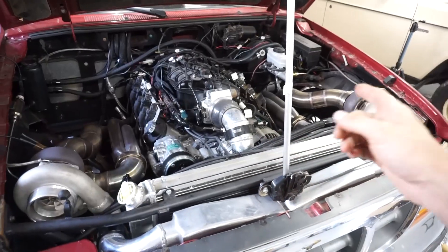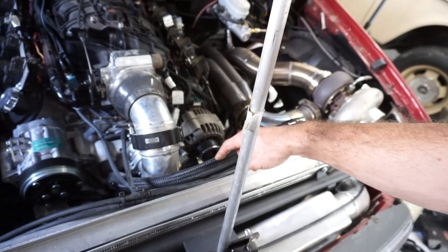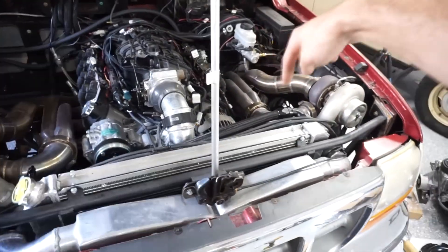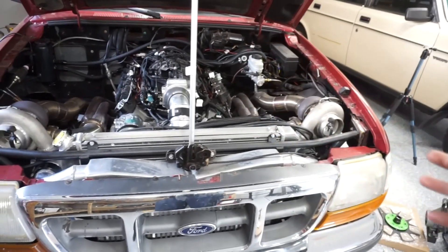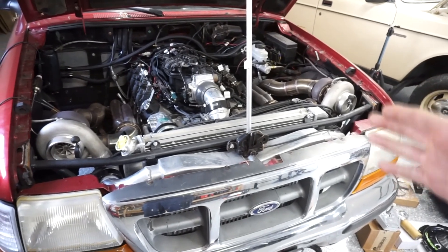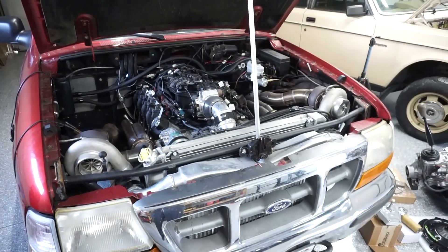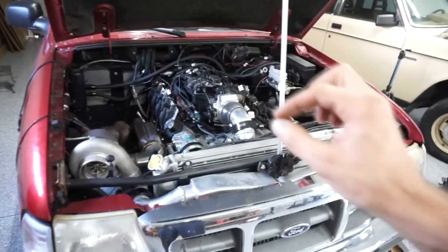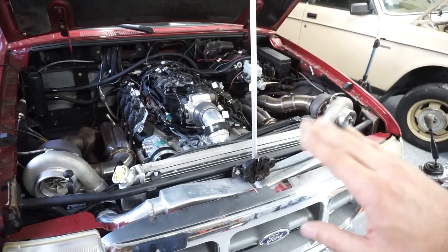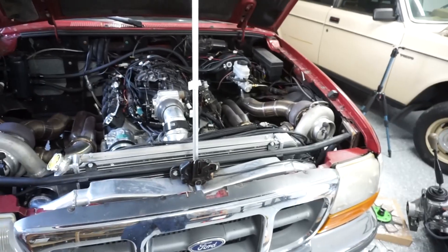One person I talked to said they're reading in a water manifold block on the front. Jack Roberts said he also blocked his water pump but wasn't reading coolant pressure at the time. Matt from Sloppy just did a test where he read it from the top hose and he did have a head gasket issue - it read like 40 psi. You could read it from the tank, the head, the expansion tank, or the upper hose, so good practice would be to just have a baseline from wherever you're measuring. I did do the block tester - it tests for combustion gases and changes color if there's a leak - and there was no issue. The fluid never changed color and the bulb wasn't filling up with air, so two different methods confirmed no problem.